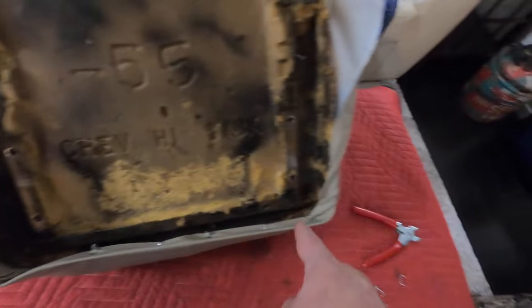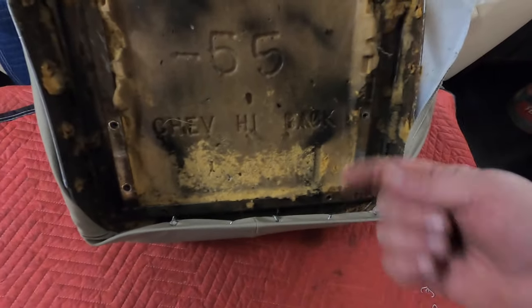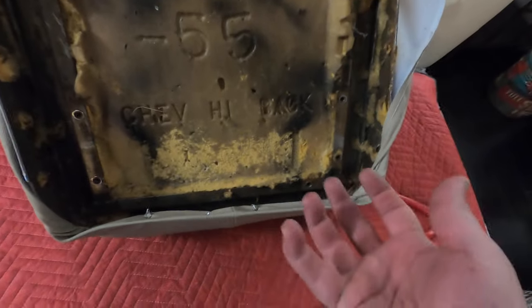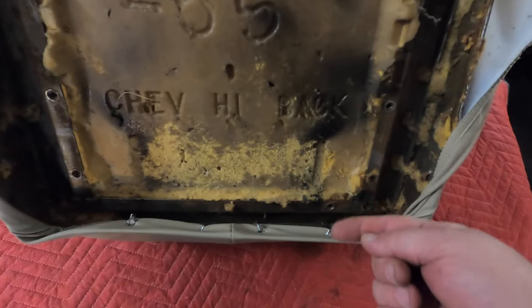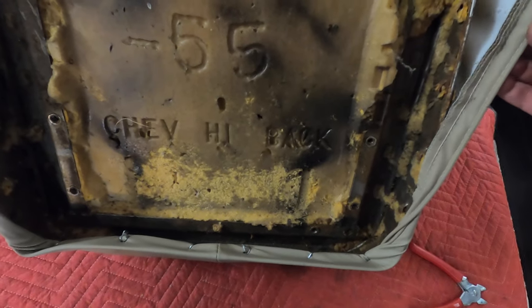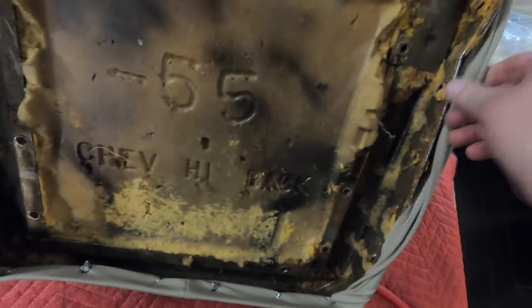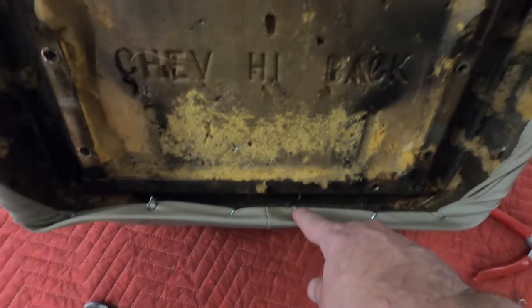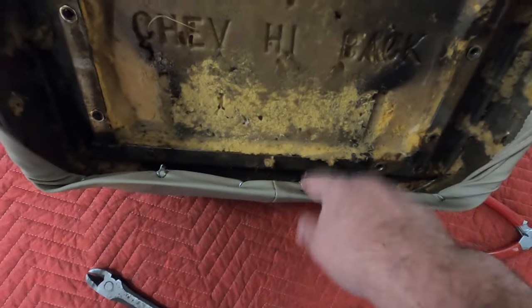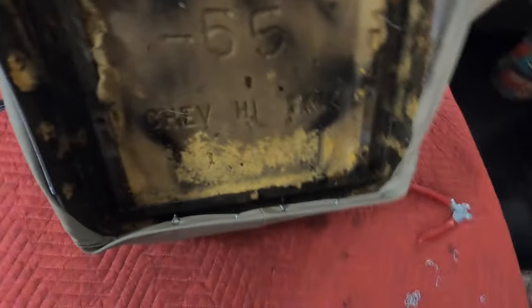What I ended up doing across the front here — this is the front of the seat — is I gave it a double roll just to keep it more taut because my foam has kind of shrunk down a bit. So I rolled it around twice, kind of around itself like this. That would be once, that would be twice, then pull it up and around and hog ring it on. Here I missed once — I just left the old hog ring. Let me flip this over and show you what we got.